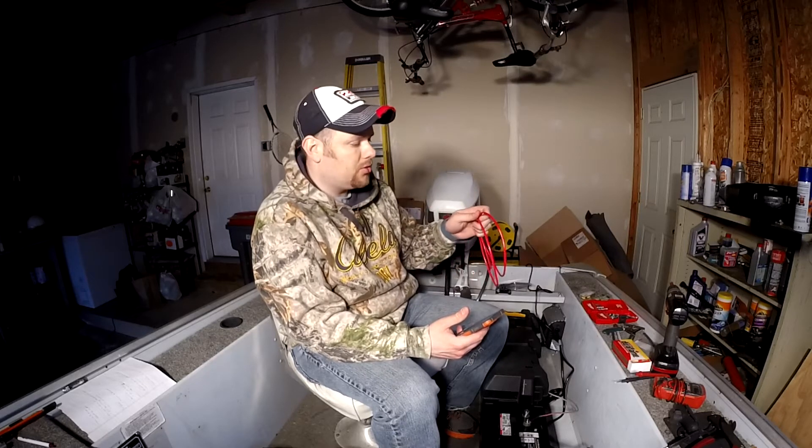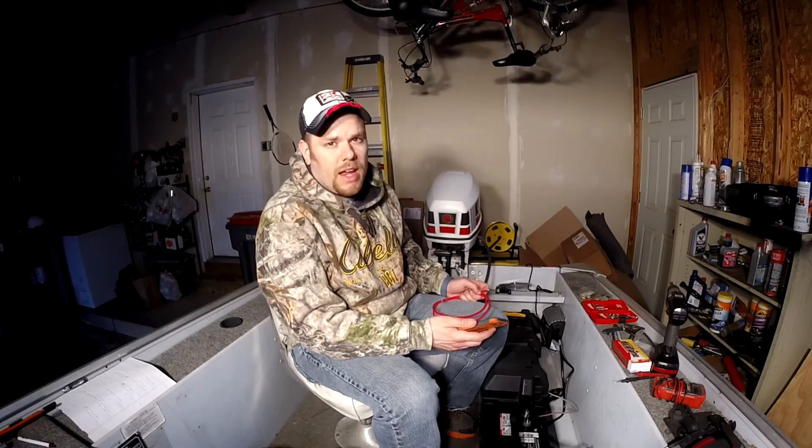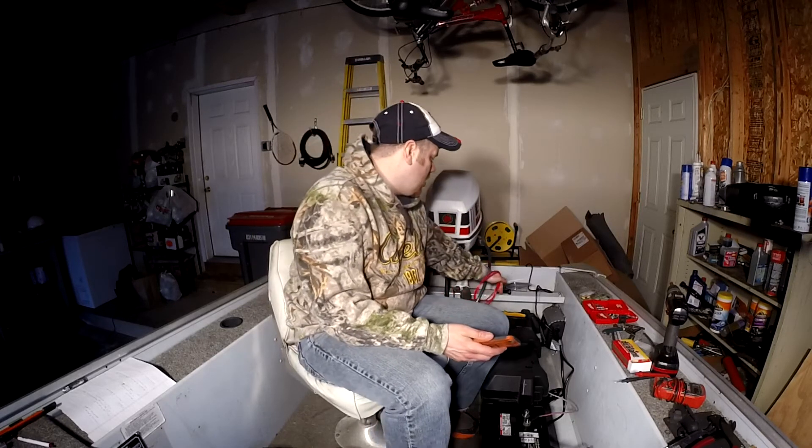So what I have to do is go back to the store and get some 8 gauge wire — I looked up the table and 8 gauge is rated for 75 amps, which will be plenty to cover the safety margin and not melt the wire. I'm going to have to pause here for today and pick up another day once I get the correct parts. Thanks a lot guys, and remember you always have to stay safe when you're working on this. This will be continued once I get the correct parts — thanks everyone.